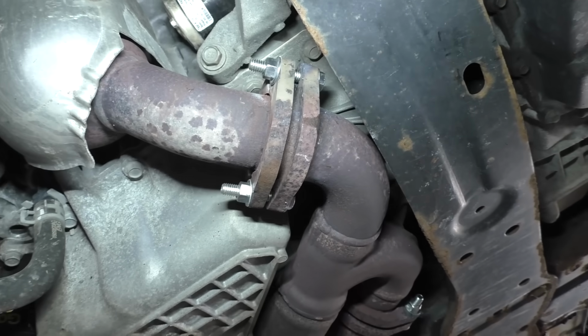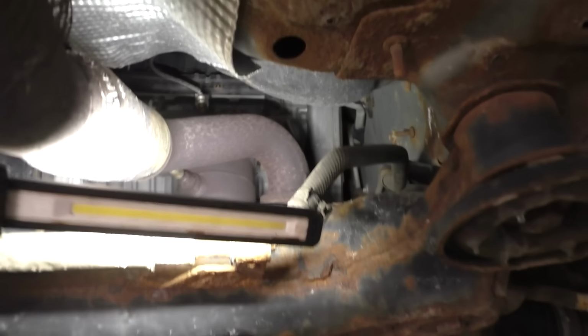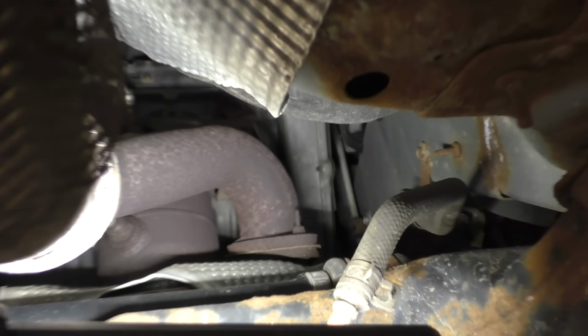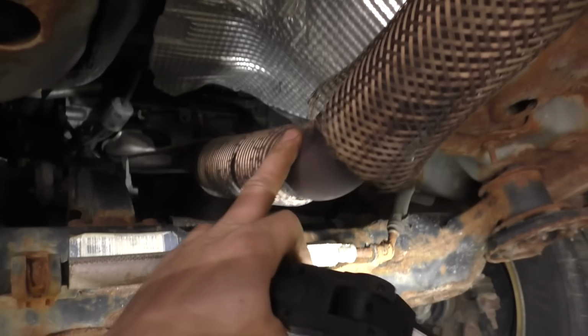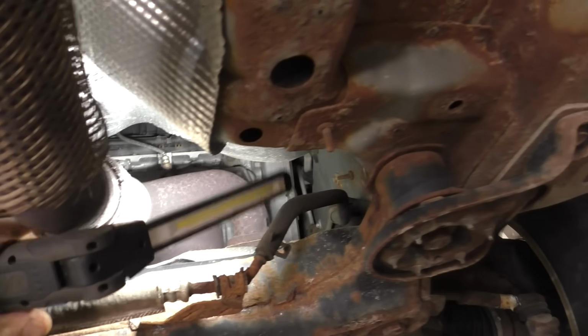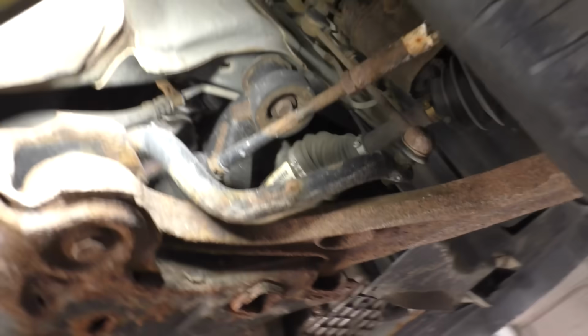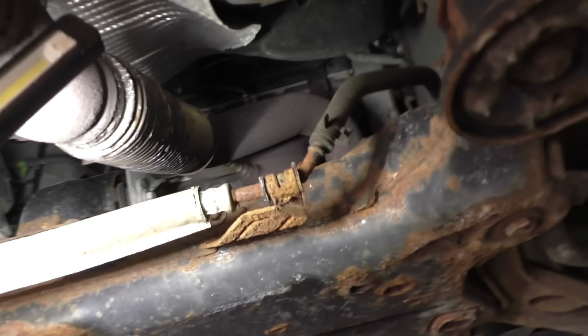So that's what those look like now, and really not much to look at. Couple bolts and a couple flanges. Now, the good news is, where these ones had the nut welded on there, it's also the same for this pipe. But if you look up there, you can see, let me see, enhance. The welded nut is actually on the section of the pipe that we're changing. So that'll be helpful to us because we can reach up in here with a torch. Hopefully, maybe through the fender. Well, one way or another, we'll get the heads cut off the bolts.